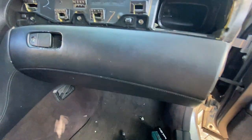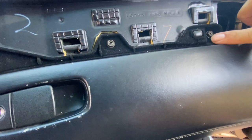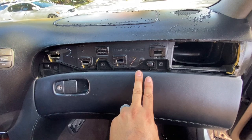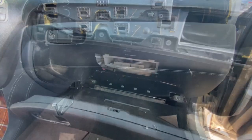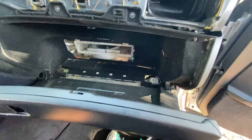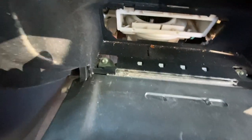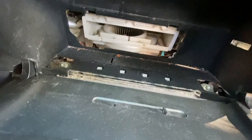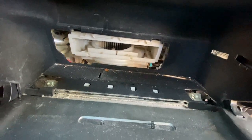Here you're going to have some Phillips or 8mm socket screws — take all three out. After you take out those three 8mm screws, wedge all this out and it should come out. I figured out why they went from a double compartment to a single: there is an airbag here for the knees — it says right there 'knee airbags.' There are two bolts up here and it does not come with the double compartment, which is why they took that out.